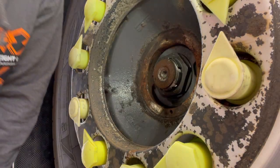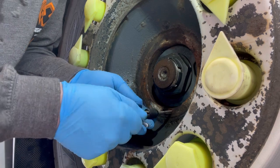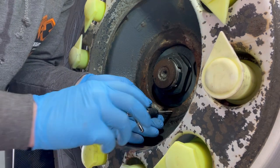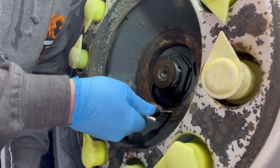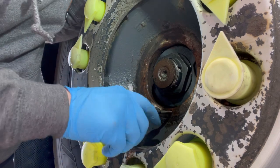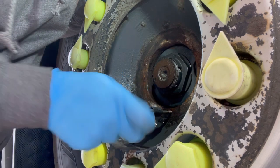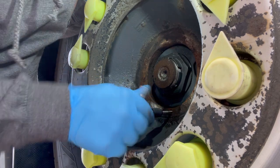So we're gonna get this bottom one, just had to put a drill bit through it just to clean it out because it still had shit in it. So like we said, start it a little bit, wind it off a bit, a few threads in, wind it off, and repeat that process. A bit of lube, a bit of brake cleaner, whatever. There we go, it's moving in nicer now. Doesn't take long just to do it properly. Nice and easy job that.